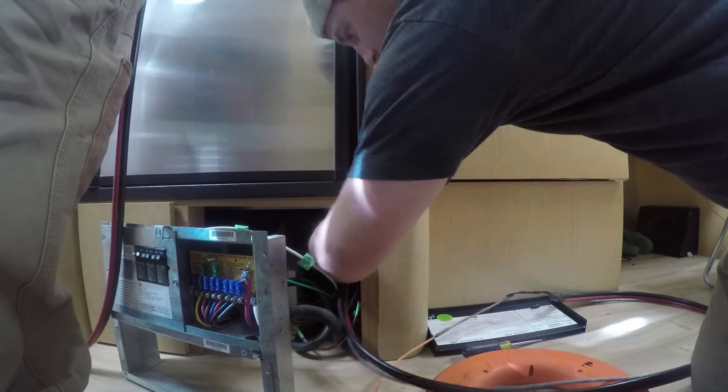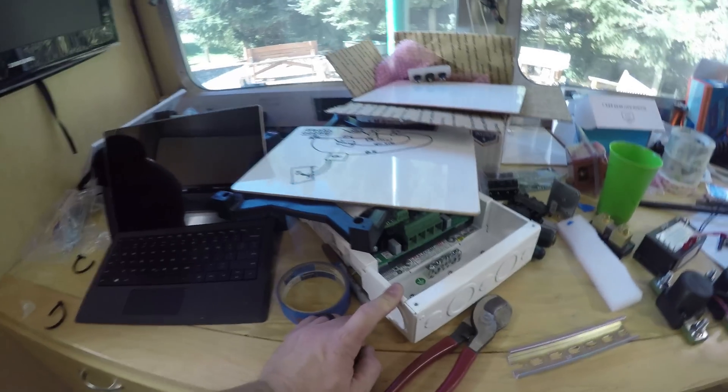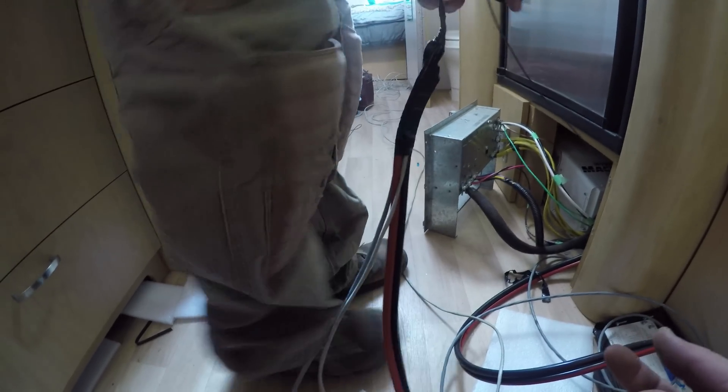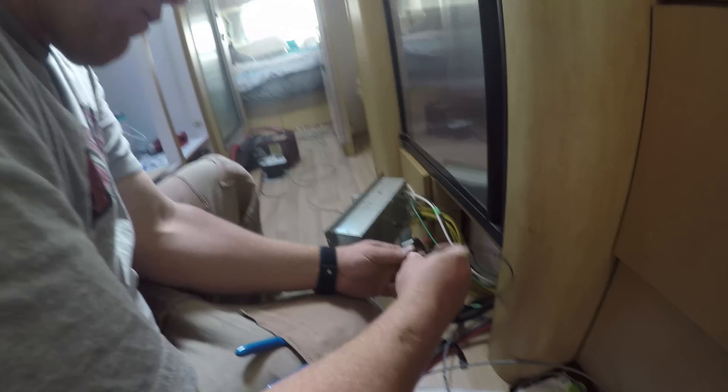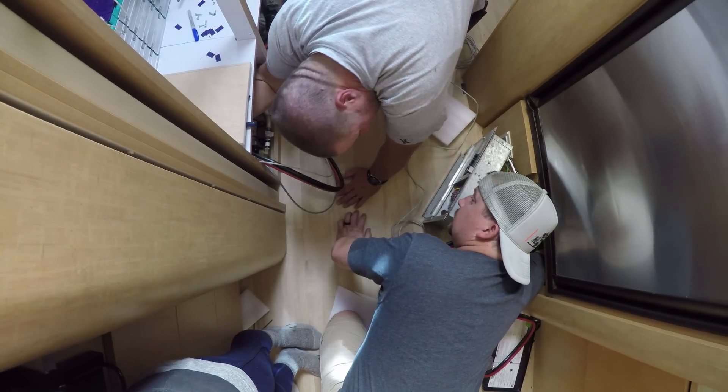We have to manage this mess of wires. There's the remote panel for the battery system monitors that we want to tidy up. This is the network cable for the charge controller to talk to the inverter. And this is the four-gauge wire coming from our junction box on the ceiling — our combiner box from the solar. We're going to run that all under and get it on the right side of the trailer. There aren't a ton of options on these 30-foot models.